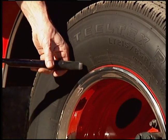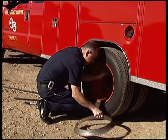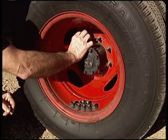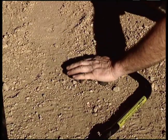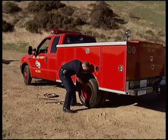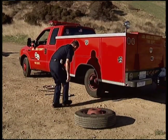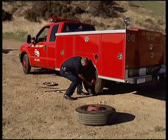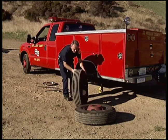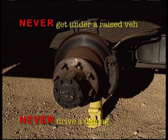Your vehicle may have wheel covers that require special tools to remove — these tools must stay with the vehicle. Finish removing lug nuts and make sure to place them all together for easy retrieval. Remove tires and lay them safely on the ground; do not lean tires against the vehicle. If the wheel feels stuck, pull on one side then the other in an alternating fashion. Visually inspect the wheel well area for signs of damage and leaking fluids. Never get under a raised vehicle when the tires are off.